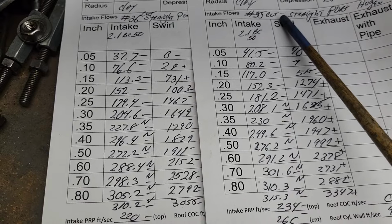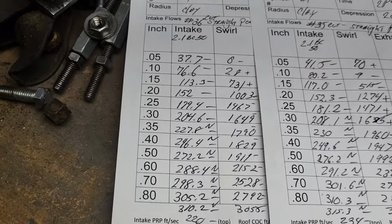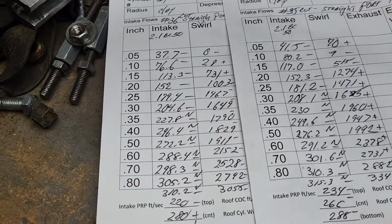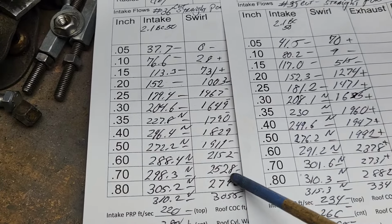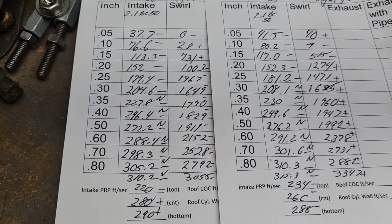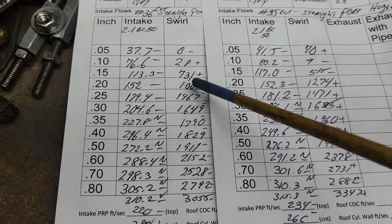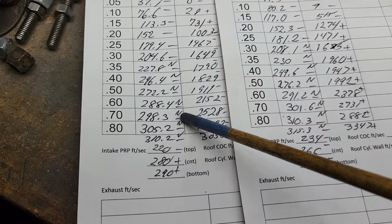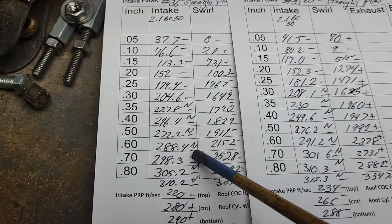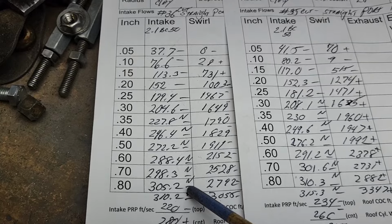Okay, guys, this was our 35th cut. It's when I first made it a straight port. This is the 36th cut, the first cut on top of the straight port. Was it a winner? Now, I added a lot of bowl area, and I made it so you could feed the center of that chamber a little easier. Did it like it? It doesn't look like it. All negatives. The bowl was already too big, too tall, too wide. I gave it more area, and it said, not happening.